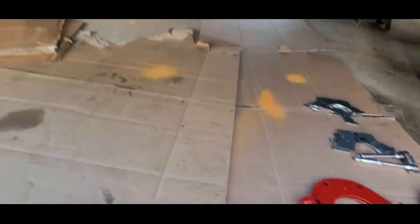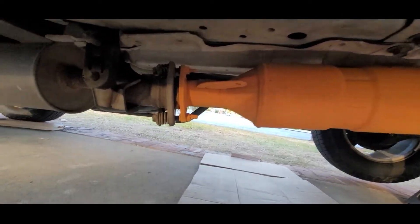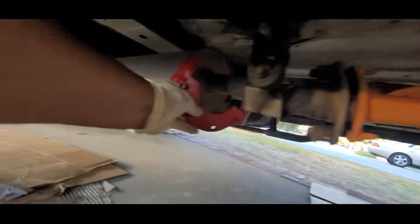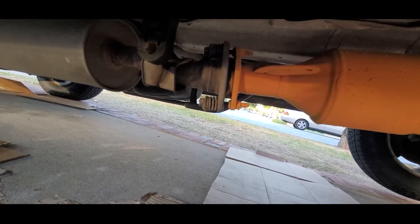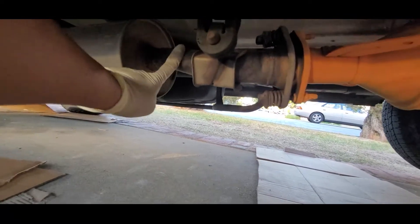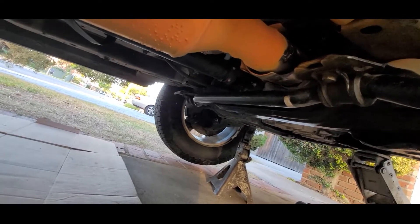To decide which shims you need, first make sure where you're going to set it up. I'm going to set the first one right here. Some people put it elsewhere, but after looking at pictures on Google of people installing it, I decided to set it up here. Now, if someone cuts it from here they could take it, but what's going to do the real job is that I'm going to run the wire between the stabilizer bar and the frame of the car — and that's what I think is going to save the cat if it's cut from here.